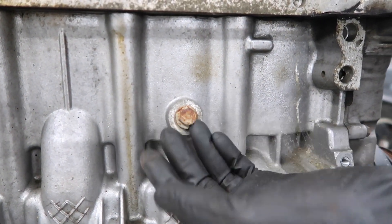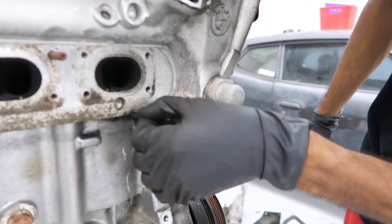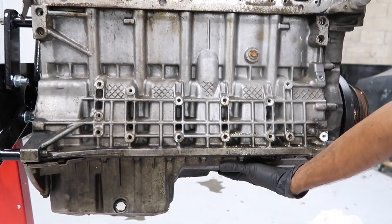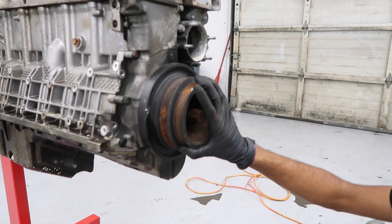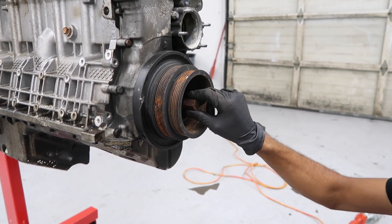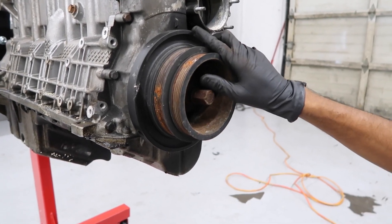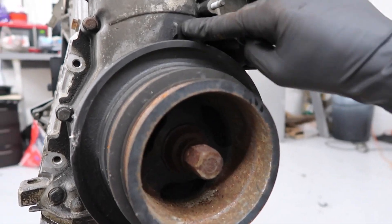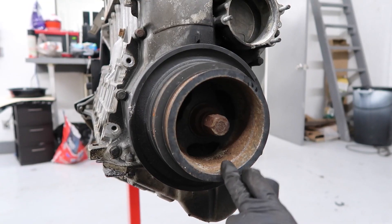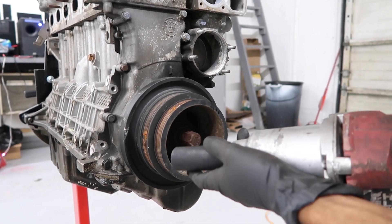There's just a little residue left over. This is also a reference for anyone who needs it: this is the actual drain for the coolant on the block itself. If you're draining the coolant in the block, you remove this and it will just drain out. This right here is the actual head gasket — you can see part of it right here — and it sits between the block and the head. The only other thing left on the bottom is the oil pan, and then we have the crank pulley here. We're going to try to remove it now. It's a 22mm bolt, and before you remove this you want to put the engine in TDC — top dead center. There's a mark on the pulley and a mark on the block; just line them up. This bolt is not reverse-threaded, so just normal lefty-loosey.